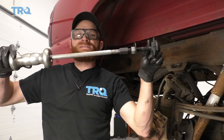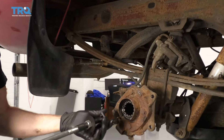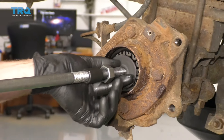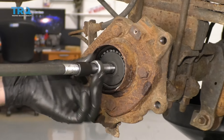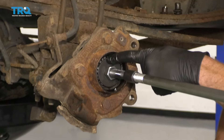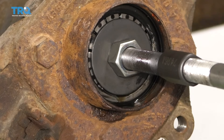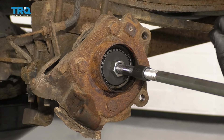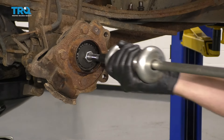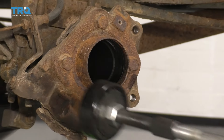You're gonna need a tool that looks a lot like this — this is called a slide hammer. The way this works is this weighted unit slides and bonks up against it to draw the bearing out. Turn it just like this, slide it in there, and put it right up against the bearing as close as you can. When you do this job, it's important to remember that more than likely the bearing is actually gonna come apart — all those little roller bearings inside are pretty much only held in by a teeny little sleeve. More than likely it's gonna break and the bearings could come shooting out, so make sure you're wearing your safety protection.